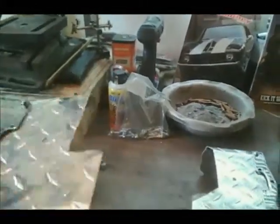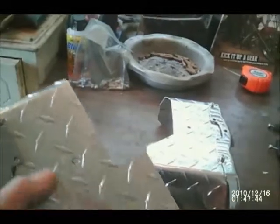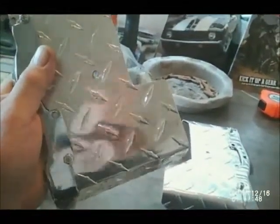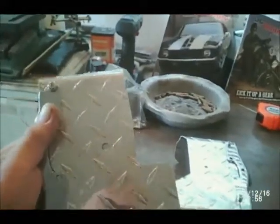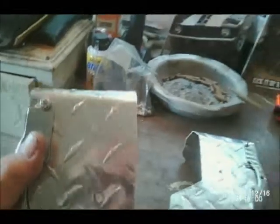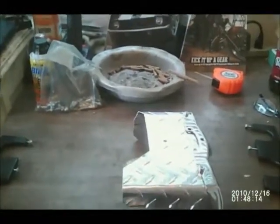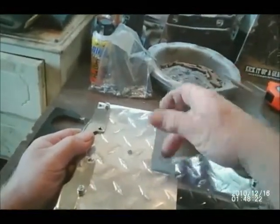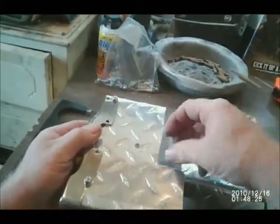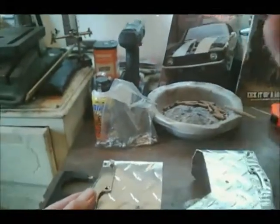This will be the left hand side of the bike as you're facing forward. The hole right there with a little bit of green around it — that is for a little snap-in holder for the spark plug wire loom. That's how it would look if you were looking at it from the radiator side. It has to come up because there's some wiring that runs through here I wanted to avoid, and then this opens up right here to allow for the throttle and choke parts to swing freely. This also helps to vent warm air from the engine up towards the bowl on the carburetor.